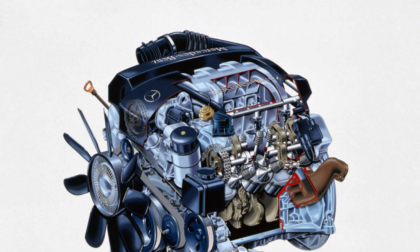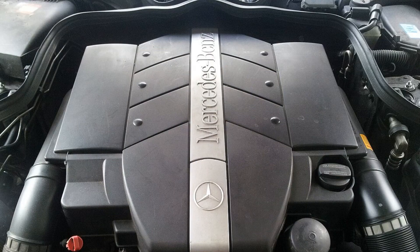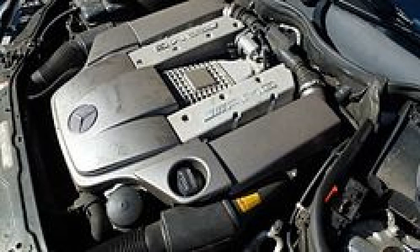Characteristics and features of the motor: The Mercedes M112 3.2 engine appeared in 1997, along with other motors of the 112 series. Unlike its predecessor, in the M112 it was decided to move away from the inline type of engine and build a new V6 in a V-shaped version with an angle of 90 degrees, which allowed increased compactness of the power plant and maximum unification of the V6 and V8 M113. To balance the moment from the forces of the second order, a balancer shaft was added.